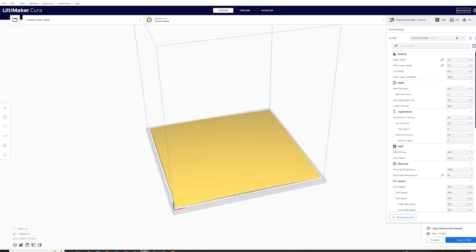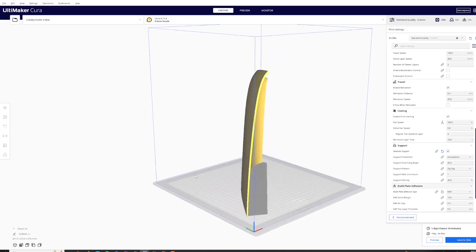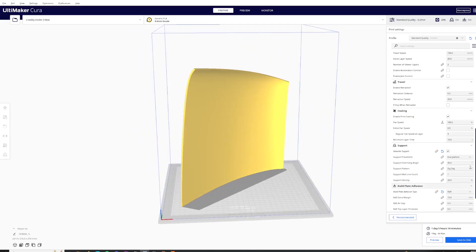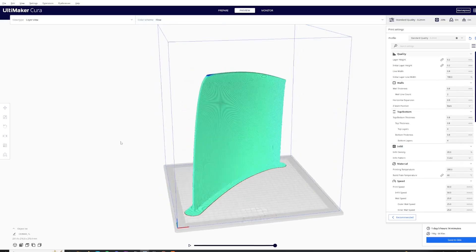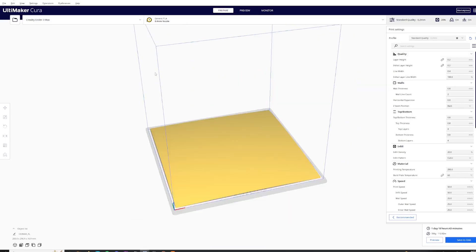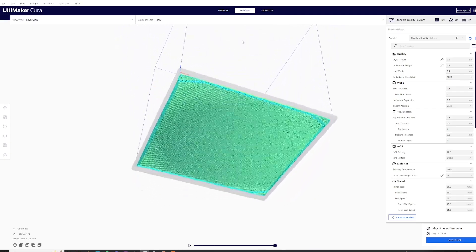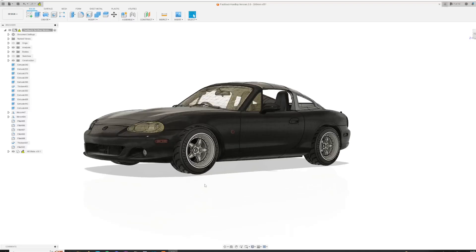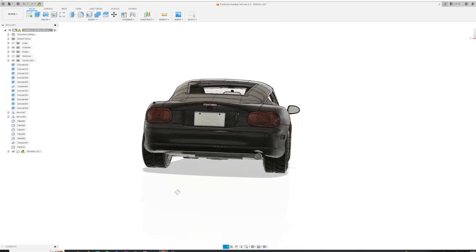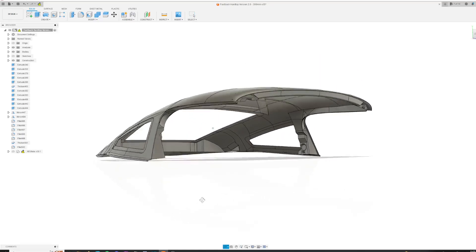As far as material goes, I recommend PETG or ASA since they're less affected by exposure to the sun and heat than PLA. I've included my print settings in the description to help people print all these parts as fast and dimensionally accurate as possible. For parts positioned vertically on the bed, I recommend using a raft for bed adhesion; for horizontal parts, use a brim. You might need to tweak these settings for your specific printer. The total print time should be about two weeks printing non-stop, and expect to use about seven to ten kilograms of filament, which can range from about $140 to $250 depending on brand and filament type.